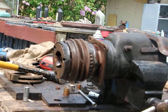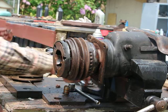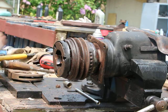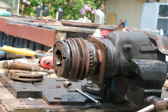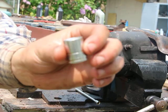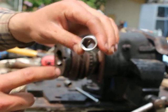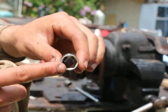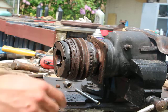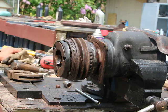And what I've done so far is, I know the manual says you need some fancy thin wall wrench, whatever, it's bullshit. I just used a 9/16. This is the thinner wall, right? But it's nothing special, usually a 6-point, guys. So there's 1, 2, 3, 4, 5, 6, it's 6 sides, right? You use the 12-point ones, it can be easier to strip the head and make it round, right?